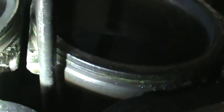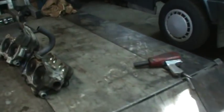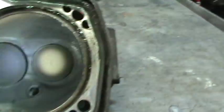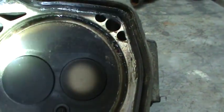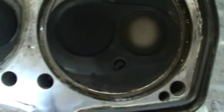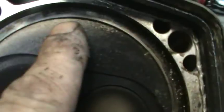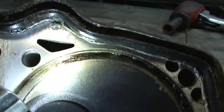This side kind of looks okay, and I had a feeling it was coming from the other side. If you look — see that little green o-ring? That's the other part that seals it, keeps the coolant away from it. And that fits in the head. You can see the groove that it fits in. This is the head that came off the driver's side that I suspect is failing. Right there — definitely, definitely this one right here. That's burnt like all the way through, so I think that's where the failure was happening.